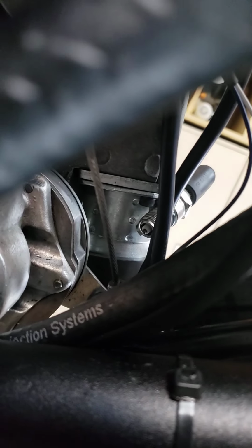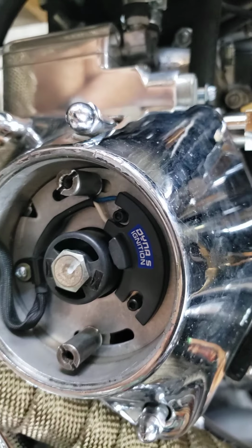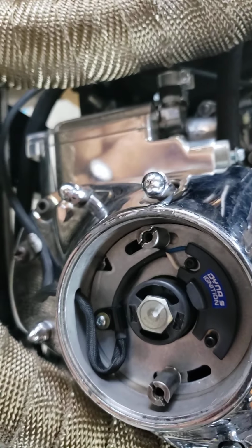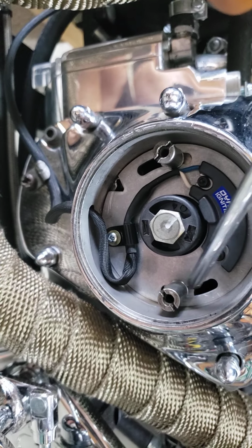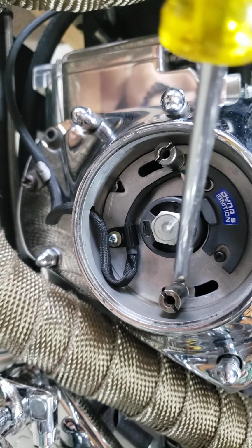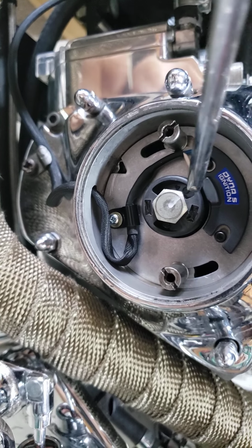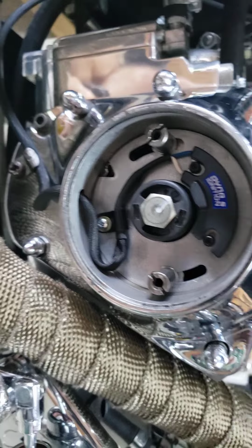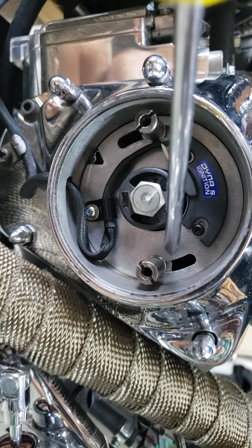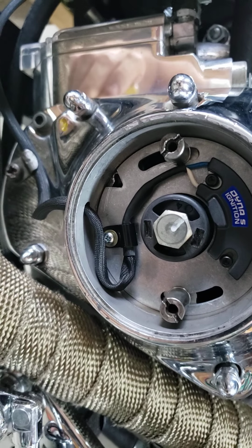Although you may or may not be able to see all this, the end of the plug down there, yeah, you can see it. Anyway, these both fire off at the same time. I have the front cylinder at top dead center. If I was timing to the rear cylinder, it put this plate all the way down to this slot, all the way down against that pillar bolt before it started to spark. And if I retarded it all the way back, I believe this is retard, advance, I don't remember now, to here, it would also spark at the end. So it would spark here and it would spark there. I thought, no, this is not right. It should be sparking somewhere in an adjustable range. My other one was set just about an eighth of an inch higher than this, which I had marked on that plate. So I knew something was not correct.